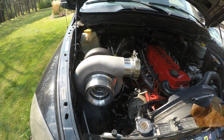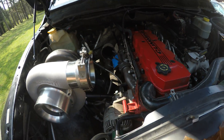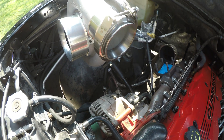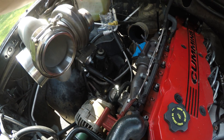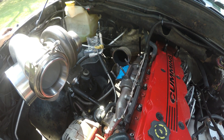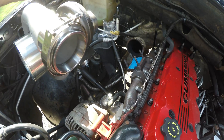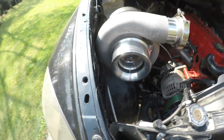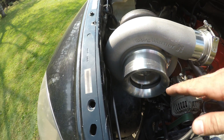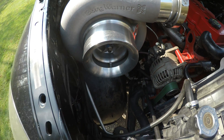Alright, here's the turbo mounted in the truck actually. The mount looks to be doing pretty good. I have to finish weld it and everything — I've just got it mostly strongly tacked together, and the secondary turbo is out of here so you can see everything that's gonna go on. I should be able to get the hot side done here pretty soon. I'm still a little worried about the downpipe. Once I get the one that's in here out and get the hot side pipe made, we should know more about how the downpipe's gonna fit. I want to run a five inch — I've got a five inch on here so hopefully that'll work. Doesn't leave me a whole lot of room for filter space, so I'm just gonna have to run a small one or see if I can get a tight radius six-inch bend and go down here, run a big filter down here, and maybe cut some of this plastic out so I can get some more fresh air.